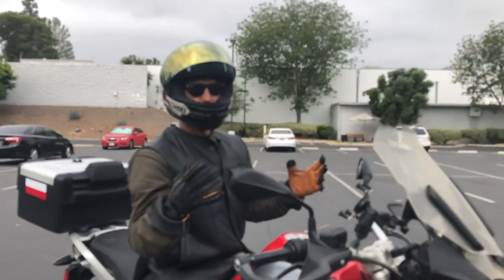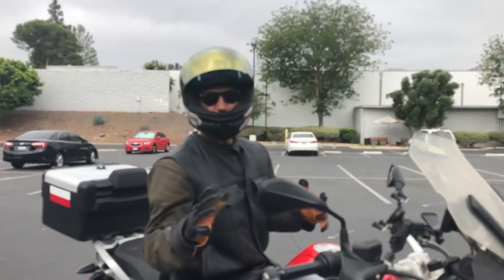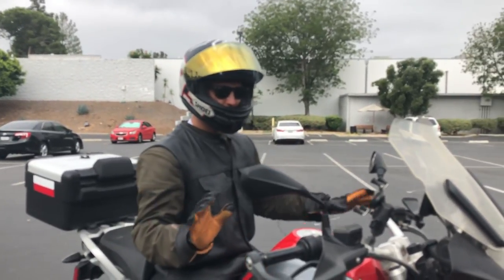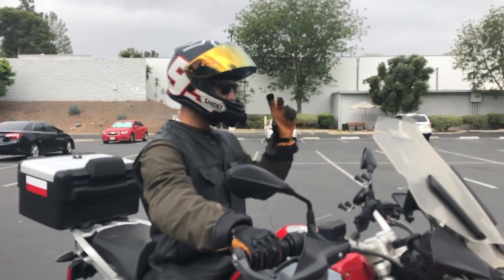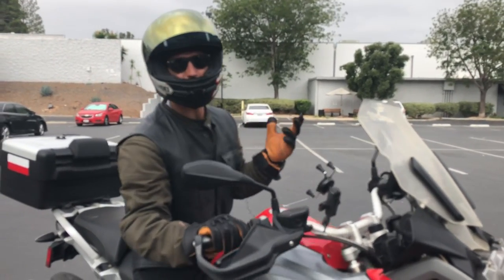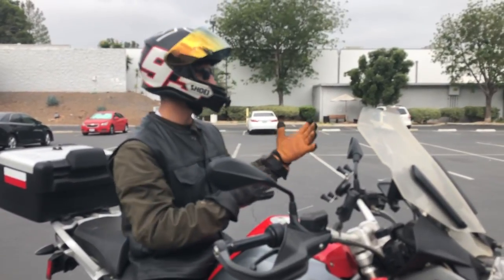So if you couldn't see too well, sorry, no big deal. Or I try to get the phone without stalling the bike. Either way, the main idea is what you saw me coming down and just pushing forward on the bar. And I was holding it with one hand and I wanted to go left. Well, how do I go left if I can't push left? Remember, you could go left by pushing left, or you could go left by pulling right, and that's what I had to do. Either way, it's a forward or backwards input on the handlebars to allow yourself to do this.